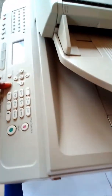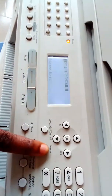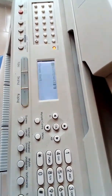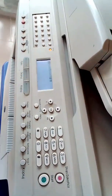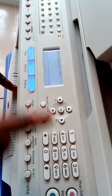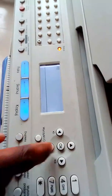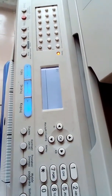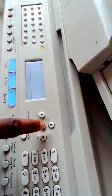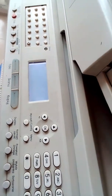Are you seeing me now? As you can see, our machine is booting. Take a closer look at this screen — you can see it is showing maintenance. Once it is showing that, you just release the menu button. Once it shows maintenance, the next thing to do is look at these other keys here. You click 88 — that is 88 two times — and it shows RB on our screen. Then you press the up arrow key. It shows RV. When it shows RV, you press the up arrow key three times: one, two, three.